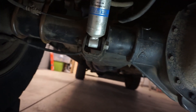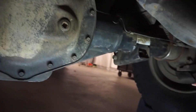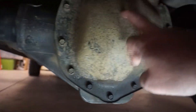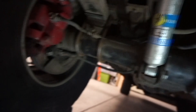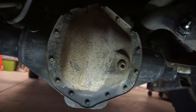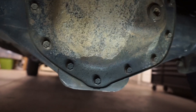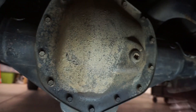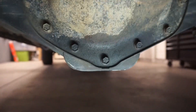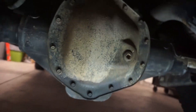We got some dirt and debris off of here — that's about as good as we're going to get today. I do have future plans of pulling the bed off and getting the whole back end media blasted. For right now I'm just trying to make the pumpkin area look good so when I put some paint on it, the diff cover doesn't look all nice and shiny while everything else looks like crap. As you can see, this diff is leaking — I think there might be a hairline fracture somewhere around one of the bolt holes. I've already dropped this diff cover before, serviced it, put a new gasket on, and it doesn't leak in the driveway, but sitting here it does get pretty wet, which is another reason we want to get that diff cover swapped out.